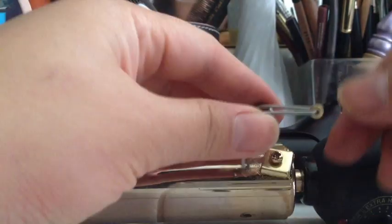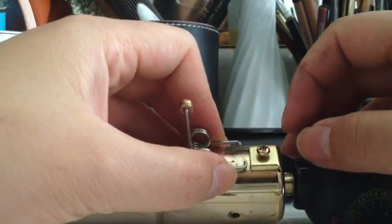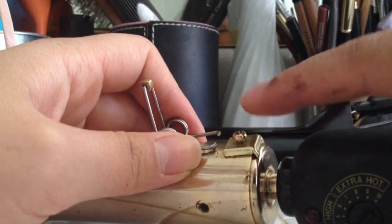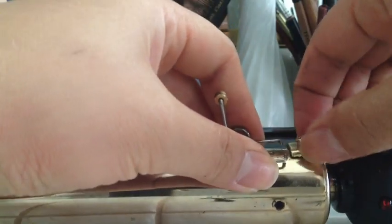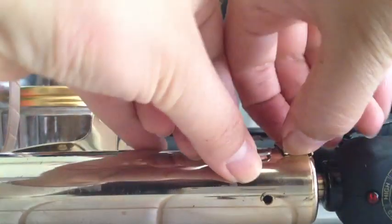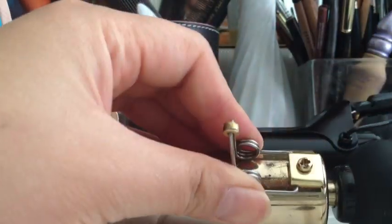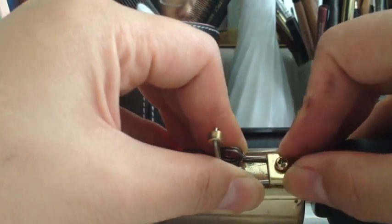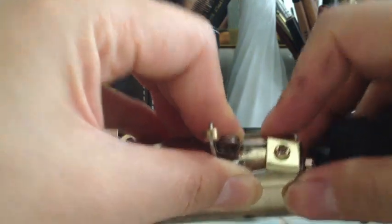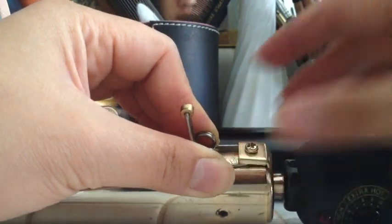This is the one I had already replaced, but I'm going to move it here. Here's a good spring. So to put it back in, you just got to make sure that it places onto this plate with this bottom part — it's a hook — kind of hooks onto the curling base. So make sure it stays that way, and you're going to lift it up a little bit to fit this under. So it kind of does this — you see what I'm doing here? So these two guys are kind of clamped in like this, within that square. Make sure it's nice and squared and tight, and then you're going to screw it on.